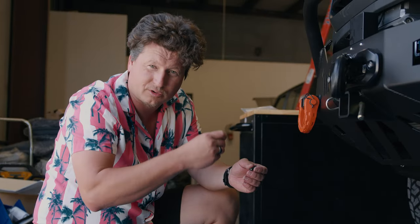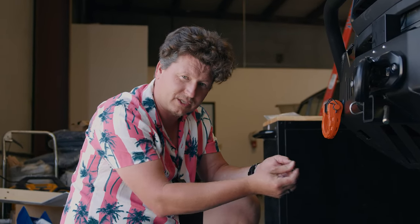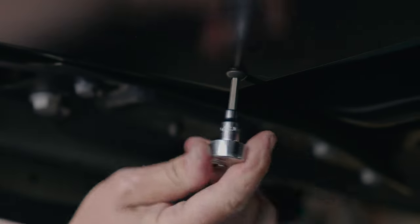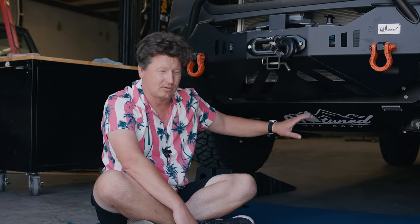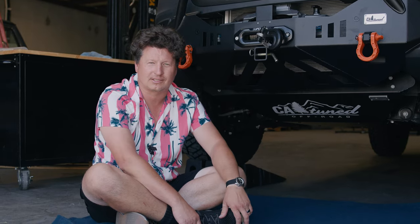Once you have the four 13s snug, you got the other two bolts that we're going to attach to the other two holes underneath the skid. That finishes out our skid plate install. Super simple — there's only eight bolts involved. You get the hardware. Any questions, you guys give us a call. And don't forget, this is for the all-wheel-drive only models — the four by four. The earlier models will not work. So give us a call, click like, subscribe, give us some thumbs up, comment — you guys name it. Thank you.